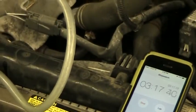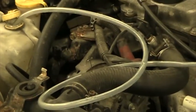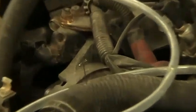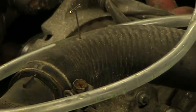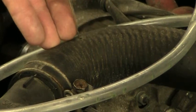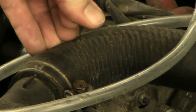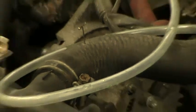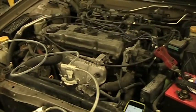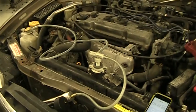Just to make this test a little better and show you what happens, I went ahead and put a pin in my upper radiator hose — right there — and that's in fact where I'm losing my pressure. If I did not have that pin in there, it would have held pressure and the system would have tested out just fine. So this one has a leak, and in this case I'd have to replace my upper radiator hose, but now I know what my problem is.